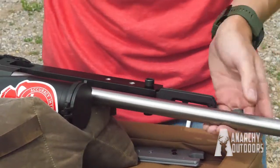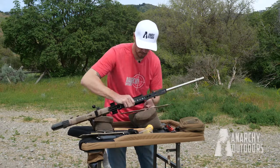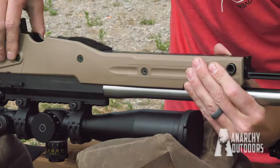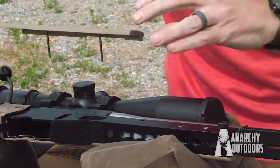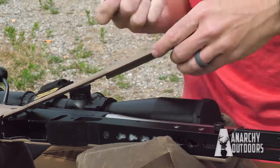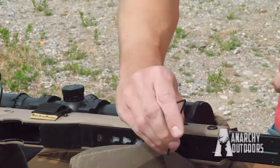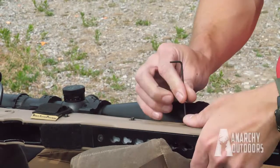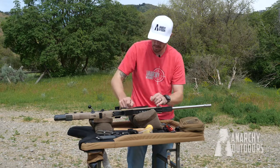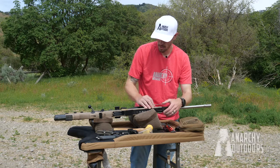Just nice and snug — you don't need to go crazy with it. You'll slip each side in there. Make sure those little forks lock in there inside over the trigger plastic. When you put this top plastic back in, you want to pull your screws out so you can slide them all in pretty easy — just like that. They're all the same length; it doesn't matter where they go. If you want to get real technical with the torque specs, I probably wouldn't go over like 15 inch-pounds on these screws. It doesn't need much to tighten them down — maybe even a little less.